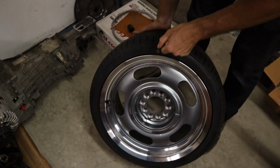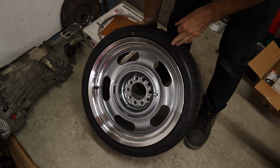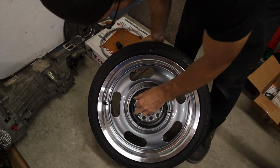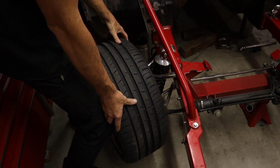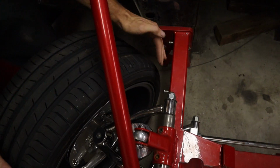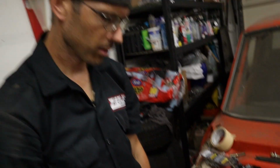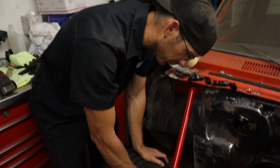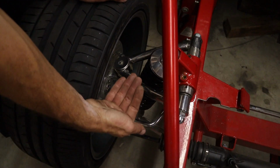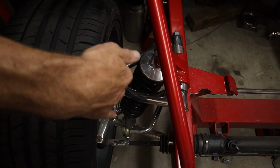And you can see that we got the tires. We're going to run a 245/35/18 on the front of this. Fits pretty good. We go lock to lock, got plenty of room, so it's gonna fit nice, gonna handle really nice. We even have a little more room because, like I said, the suspension's hanging down, so once you get the control arm straighter at ride height, it's going to bring it out a little bit. So that's what we got going on in the front.